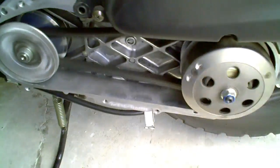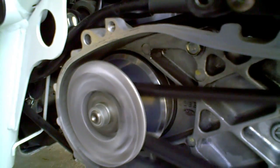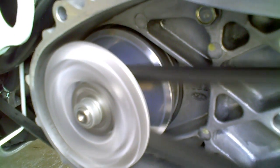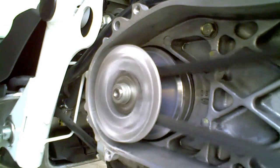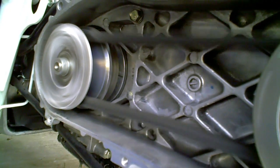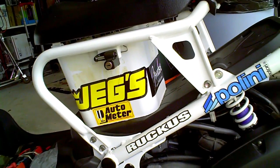There she is. The wheel's running in idle. You can see that there's not a lot of torque on the wheel. You can see the inside of the clutch there spinning around. You can see the variator spinning around. I'm just going to show you what happens when I give it some throttle. Can you see the variator moving outward? You should have been able to see the variator moving outward and moving the belt up higher.